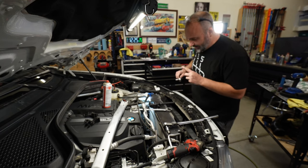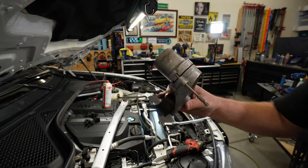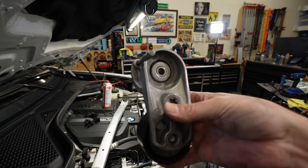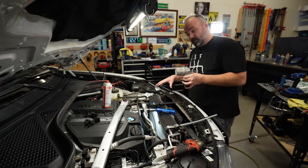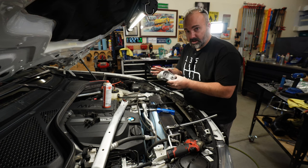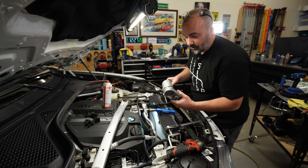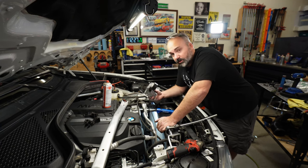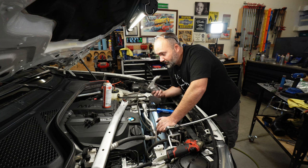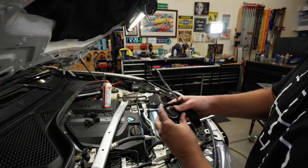Our tensioner bolt is an E12 — remember both of these bolts are supposed to be replaced. I just used a Torx drive bit to lock it into place. One of the things to watch for when inspecting your car: if you're looking at this tensioner and it's bouncing a whole bunch just at idle, the spring inside has started to get weak and it's not able to hold tension from the load of the drive system. That's a really good time and a really inexpensive preventative item to throw at your car. I don't like to throw parts at a vehicle unnecessarily, but I don't want anybody driving this — myself, my wife, grandma — breaking down.